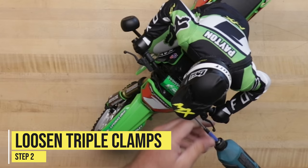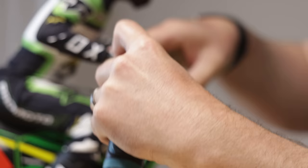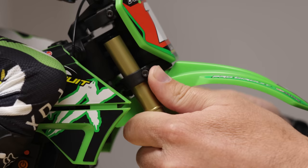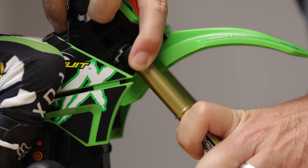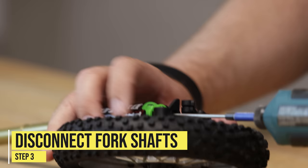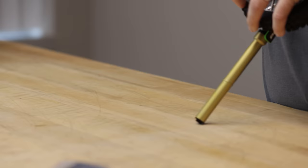I'm going to use my power driver with a 2.5 tip. You don't have to pull the screws all the way out — just loosen them up a couple of turns. Then I basically put my thumb on the bottom triple clamp and pull the forks straight down. Once you get them loose, you can just pull them out. I'll use my 2.5 driver again — there's a screw in the bottom of the fork lug that connects to the bottom of the fork shaft — and I'll go ahead and remove that.